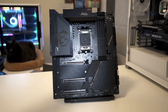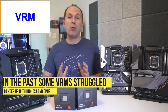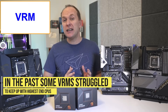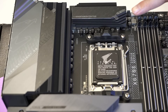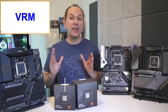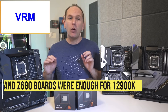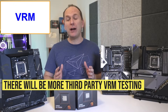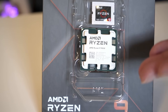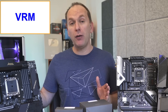Let's briefly address motherboard VRMs, which is the power delivery on the motherboard itself. While in previous motherboard generations we've often had motherboards with VRMs that just couldn't keep up with the highest-end CPUs, particularly if you're overclocking, I'm happy to report that all the X670 and X670E motherboard VRMs we reviewed are incredibly overbuilt — at least on the spec sheet — where they exceed similar specs for Intel Z690 motherboards, which were a lot more power hungry but in testing were found adequate even for the i9-12900K. So while it's always a good idea to wait for motherboard VRM thermal testing, I think you're probably fine buying any board for any of the four CPUs using Precision Boost Overdrive settings.